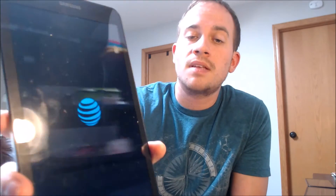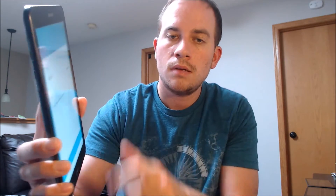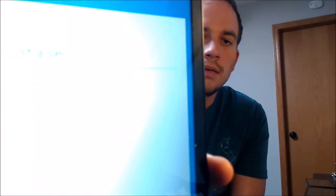After it finishes booting back up, we should be able to get all the way through the setup steps without running into that Google lock page. We're at the welcome screen — going through step by step. The first page is Wi-Fi; we're not going to need Wi-Fi so we'll turn that off and skip it. Then we have to agree to Samsung's terms and conditions. It asks if you want to add a name but we're going to skip through everything. No screen lock on the device, and there's the Google services — and it looks like we're already past the point where the Google lock page would have normally shown up.